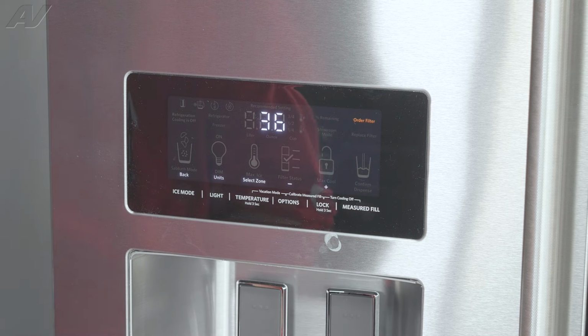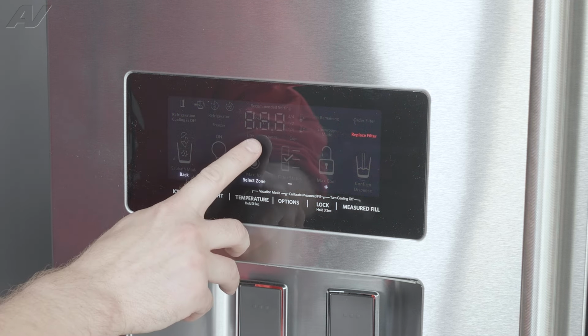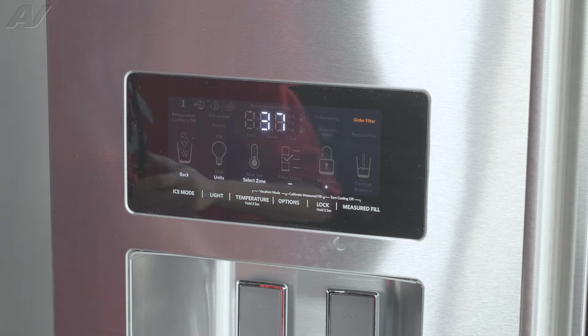And during this test, you'll want to activate it by hitting switch 3 and 1 would be on and 2 would be off. And at this point, you want to put your hand up at the top to check to make sure you're getting airflow to that ice maker. It needs strong airflow here. If you do not have strong airflow, the chances are you have a bad icebox fan motor. Number 37 is also an ice maker test. This is going to be for the ice maker thermistor, and you'll either read pass, open, or short. Obviously, we want it to say pass.